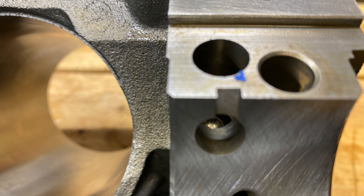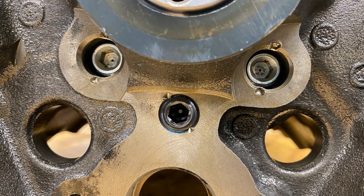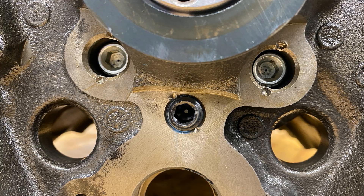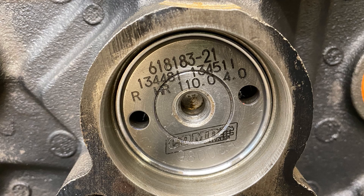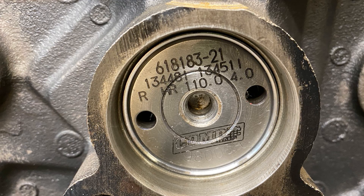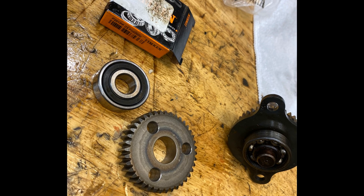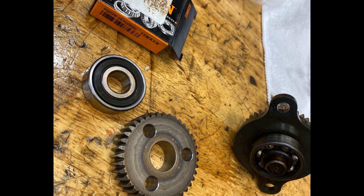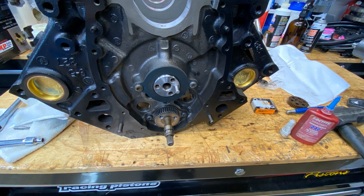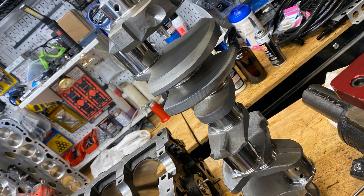See that steel ball in the oil galley hole? That's the plug in between — it separates the oil filter passage so oil can go to the oil filter. There are the front galley plugs. Just before I put the rear camshaft plug in, that's a picture of the serial numbers of the camshaft. I found a way to refurbish the water pump drive with those Timken bearing bushings. That's the front of the block with the water pump drive and the camshaft installed.